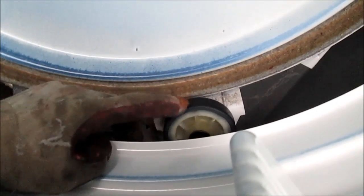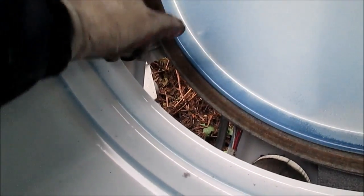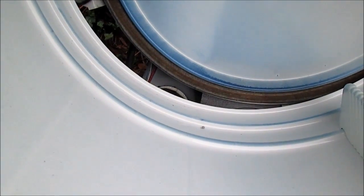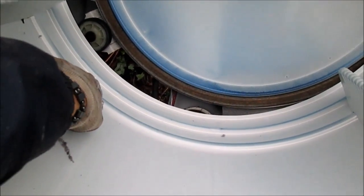Here we see the rollers exposed. These rollers are good — they're not squeaky or anything. I always lube them anyway when I have the chance. We can also lube the belt idler from here — you can see it right there at the end. You can put a couple of drops of oil on there, but be careful not to get any oil on the belt. We've pulled the drum back to the maximum without pulling the belt into the groove. When we push it back, check the belt here to make sure it's not in the groove.